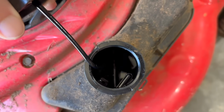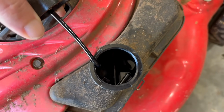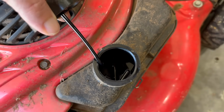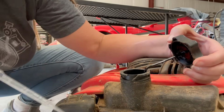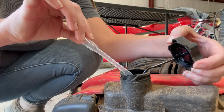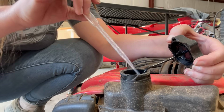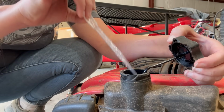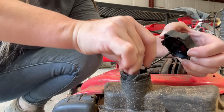She does have some fuel in her, been sitting since last year. Let's get a little suction out of that bottom, see if we got any water or trash in the bottom of that tank. I'm gonna see if I can get down in here with just my little pipette. Now, I do keep these in the description box below if you want to get some of your own. Everybody should have something like this, even to check your 2 strokes, get down to the bottom, make sure you don't have any water debris starting out this year.